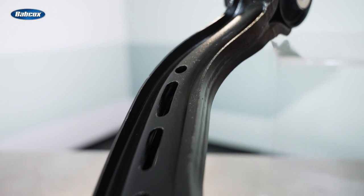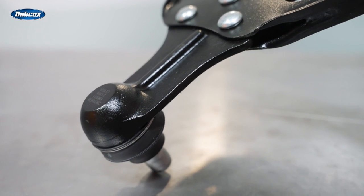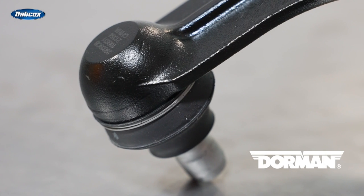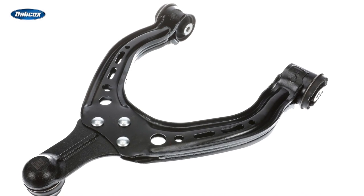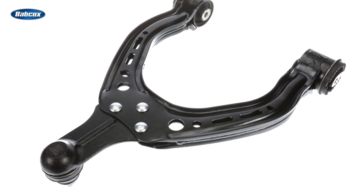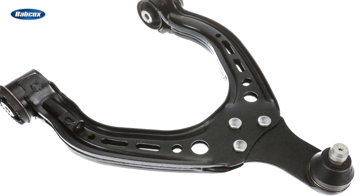As part of its OE Fix program, Dorman has redesigned the Tesla control arm assembly with stamped steel arms attached to forged steel housings in which the ball joints sit. The Dorman replacement control arm reverts to the conventional design that's been in play for decades, eliminating the plastic water trap in the Tesla OE design. To help prevent damaging corrosion and moisture intrusion, the arm is electrostatically coated and the ball joint is protected by a completely sealed housing. Also, the Dorman OE Fix control arm is significantly stronger than the hybrid steel and FRP arms found on the Tesla models mentioned.